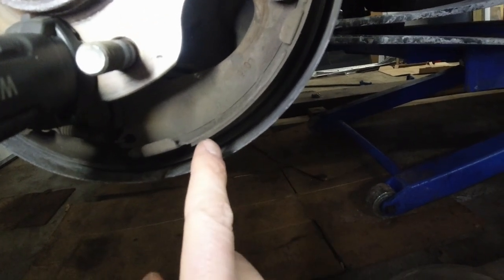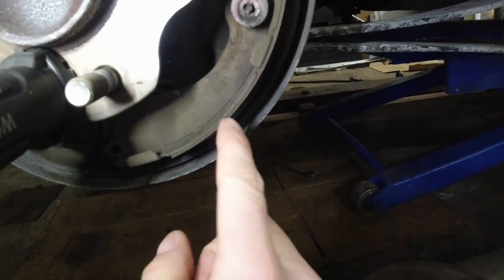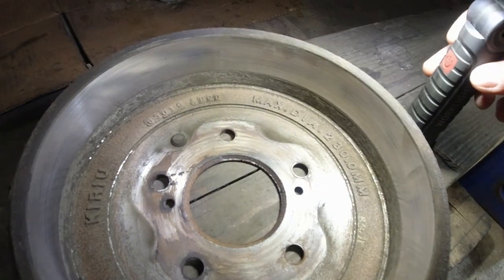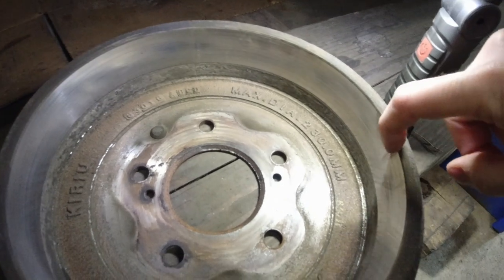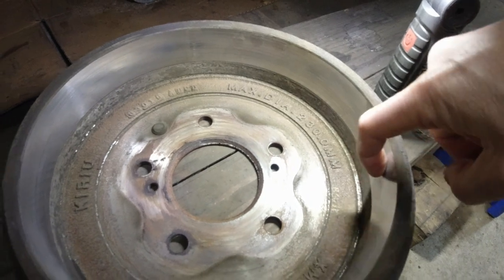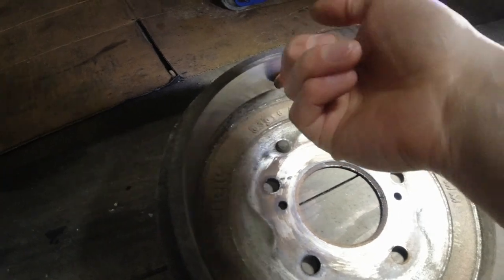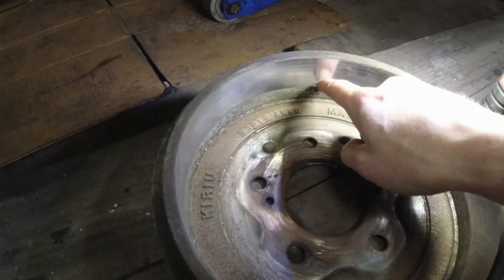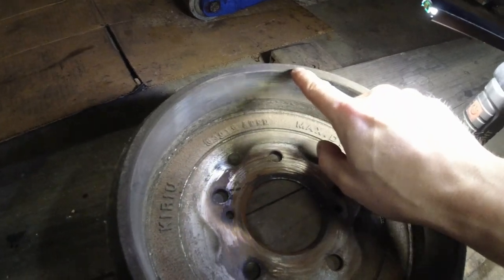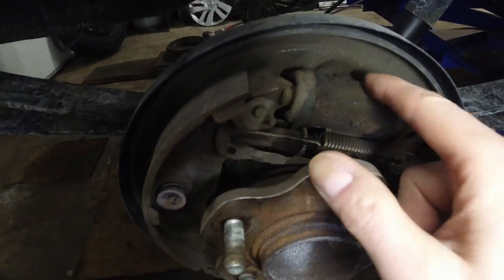So let's check this out. This is the first side I took apart. They are correct that the brake shoes are low — very low. A few more miles and this will destroy the drum. But let's look at the drum — this drum is in nearly perfect condition. It has 58,000 miles on it and it is smooth; barely catches my fingernail. I don't even have a ridge over here.